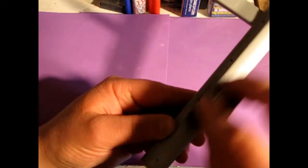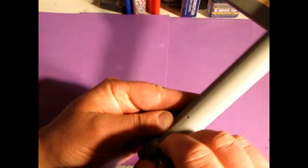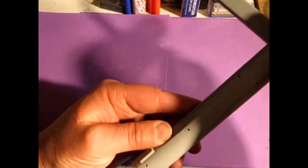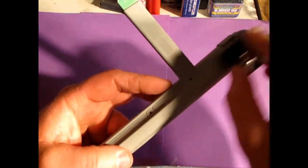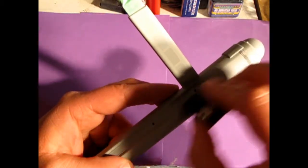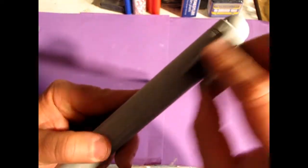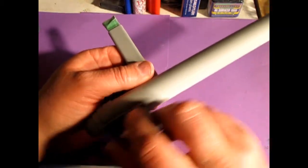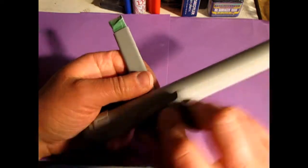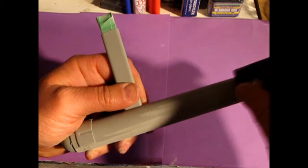Maybe I don't need the 600. Maybe I can just get a good enough tooth on here. So there's two reasons to sand this. One is, of course, to check for imperfections in that primer. And the other reason is to get a nice tooth for the final coat that's going to go over the top of this, and make it look all nice at the very end.